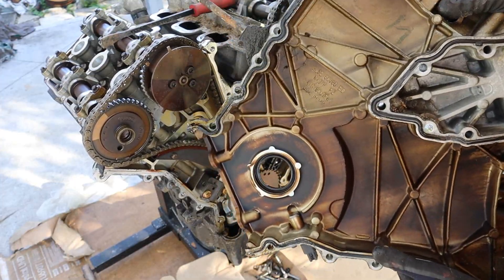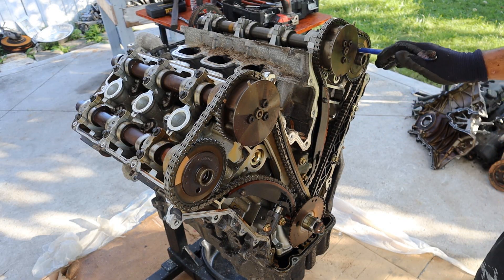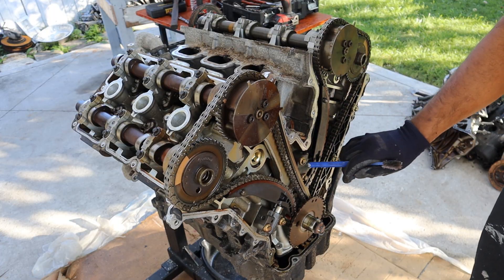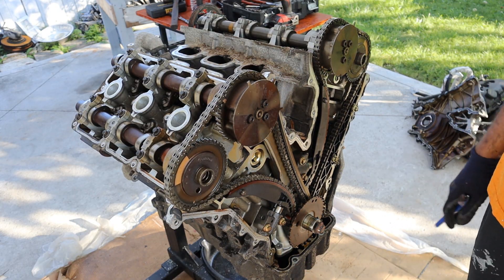I've got to say for a cover, this is one hefty piece. Taking a look under the timing cover of the Duratec V6, things are actually pretty simple. We've got our double overhead cams and two separate chains — one for the left bank and one for the right bank. Each has its own timing chain tensioner, and at the bottom the oil pump is direct drive. There's no extra chain for it — very simple setup.